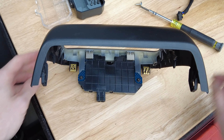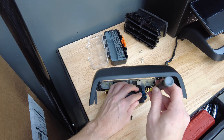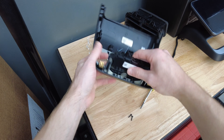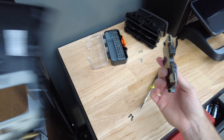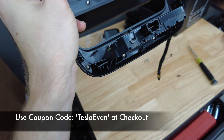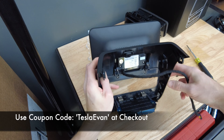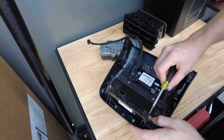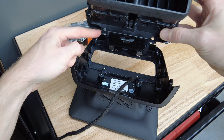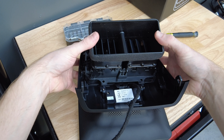Put this vent to the side and now take out these two screws that release the USB control panel. Once those are all out, slide out the USB panel and now slide in the new vent panel with the mini display. Take the same screws and place them back into the appropriate holes. Once you have that installed, take the AC vent we removed earlier and clip it back into place on the new frame — just line up the pattern of the vent clip and you'll hear it click back into place.